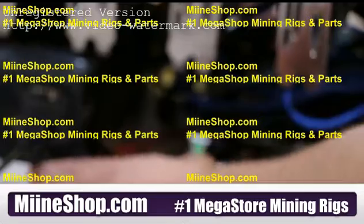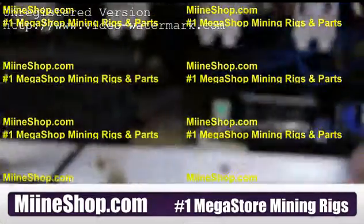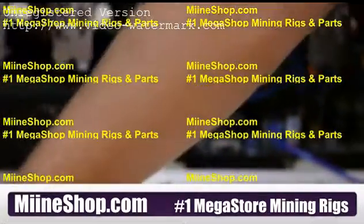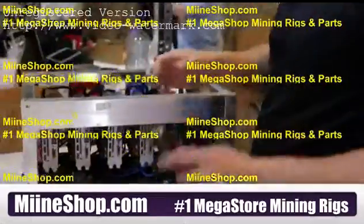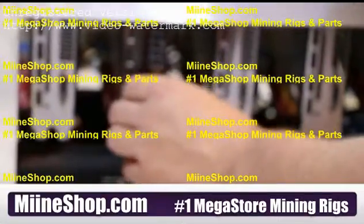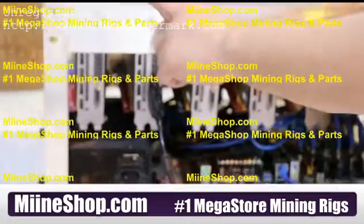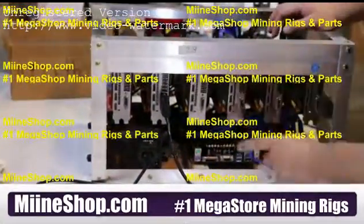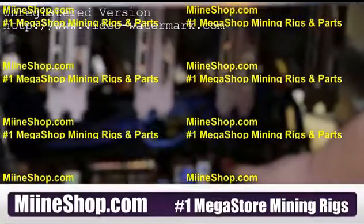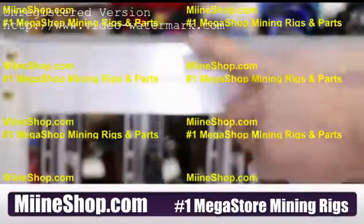So the first thing, before you turn it on, you have to flick the switch on the power supply to on, and also you want to connect the monitor before you start the mining rig to the second graphics card from the left. This is your master GPU. This graphics card is plugged in a 16x socket. The image will always be on this graphics card if all 6 graphics cards are connected.